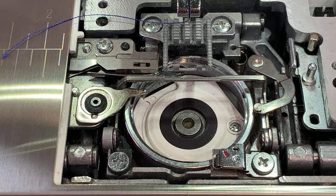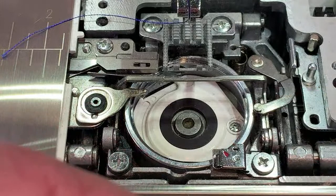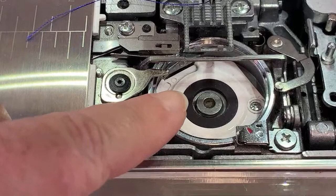You can add just a drop or two of oil right there — it is not going to hurt your machine, but it has to be high-quality sewing machine oil. Not sewing machine grease, not three-in-one oil, not WD-40 — it needs to be sewing machine oil. If the tube of sewing machine oil you have is older than your sewing machine, do not use it. We use lily white oil or a zoom spout oiler with the same recommended sewing machine oil. It only takes a tiny little bit of oil, and if you don't sew a ton, you might not need to add any at all.